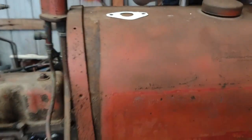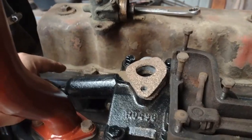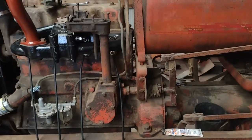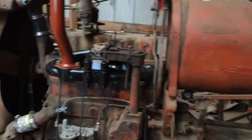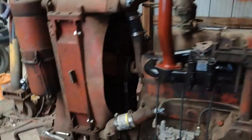I use that template to cut my gaskets — I make my own gaskets for most everything. This valve cover gasket I didn't make because it's got some funny loops in it and that takes more time. Some gaskets are worth buying, like carburetor gaskets — when they get that thin, there's no room for air to sneak through, so you're better off buying those.